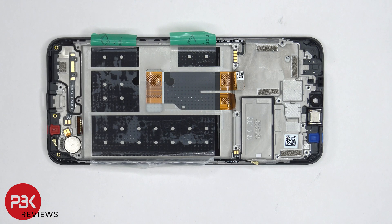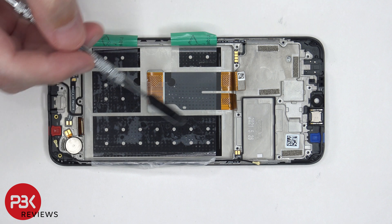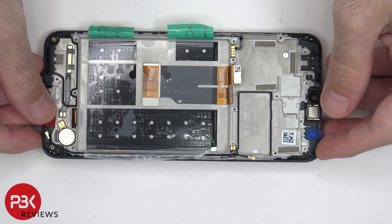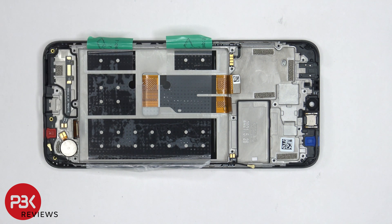When it comes to replacing the screen, you would have to remove the back cover, remove the screws, then remove the back housing. Disconnect the battery cable and this flex cable which connects the main board to the sub-board and the screen. Remove the battery, as well as this adhesive tape for the battery. Remove the speaker assembly on bottom as well as the sub-board. Then heat up the front of the phone where the screen is to loosen up the adhesive, pry your old screen off, get your new screen, apply new adhesive, making sure you run the flex cable through the openings in the mid-frame, and then reassemble your phone.